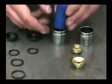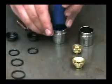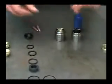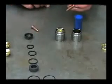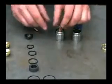Take this larger o-ring, put a little oil on that, and it will actually fit down inside of that seal ring — take the roller and push it down into it. Drop this in facing this way, then the small o-ring goes around the cup spreader. Put a little oil on that, snap that into the cup, push that into the sleeve, and then your center bolt and that new sealing washer.